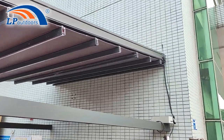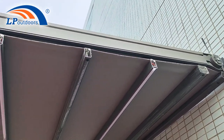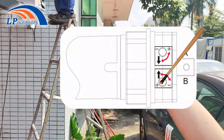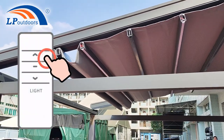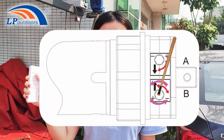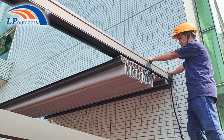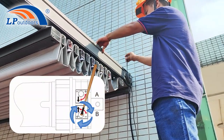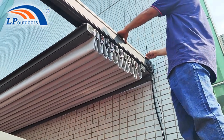When the curtain is tight after opening, check whether the first curtain rod reached the cutter and whether there is any current sound from the motor. If you can hear the current sound, you need to turn it counterclockwise until the current sound is no longer heard. Then we insert the adjustment rod into hole B to adjust closed. Use the remote to retract the curtain to the middle position and then pause. Turn the adjustment rod counterclockwise for a few more turns, and then use the remote to retract the curtain. You will find that it cannot reach the end. Then we rotate the rod clockwise. The curtain will slowly retract. Please note that there should be 3 to 5 cm between the last curtain rod and the panel to keep the rod on the track, otherwise the module will make a current sound.